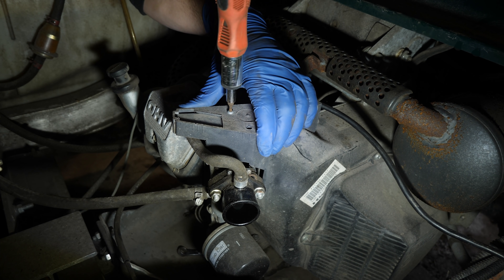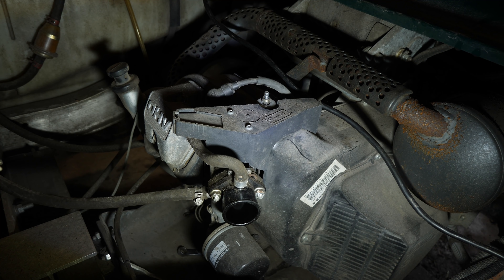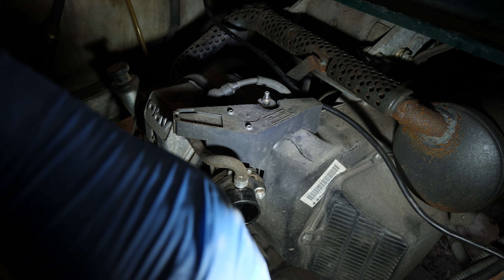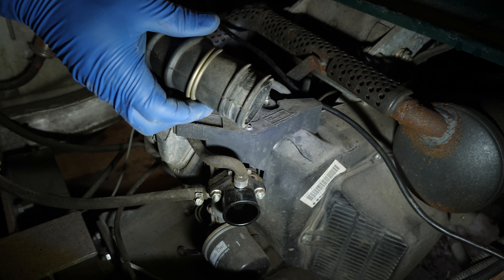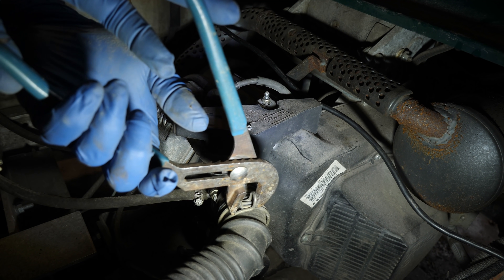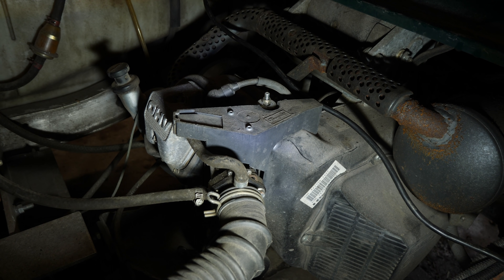Based on my experience, this is not something I can repair because of parts availability. I can't just order those parts from my suppliers. I've sent emails to Club Car numerous times and they keep redirecting me to other dealers — I can easily order from Yamaha or E-Z-GO but I can't order directly from Club Car. Now, remember with the intake hose — the end that goes on the airbox is smooth, but the one on the carburetor has a little notch that goes up against the PCV. This one's not dry rotted so it's in good shape. Air hose is back on and this is all back together.